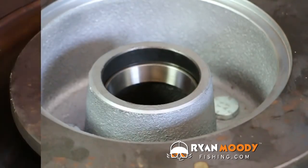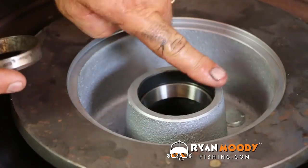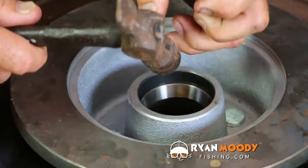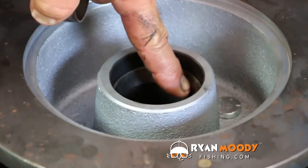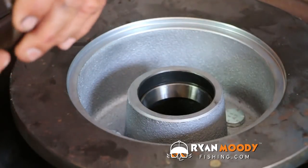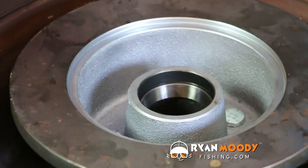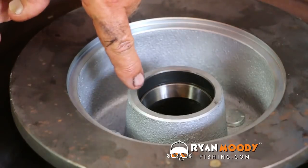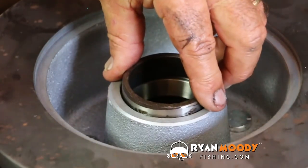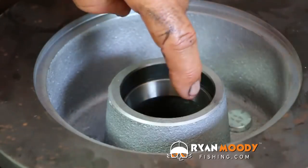But before we insert the bearing, the main point of this exercise was to show you not just how to make this tool but the reason behind it. When that sleeve was up flush, the only other way most people could get it down would be to try and hit it with a punch of some sort. But what that's going to do is you're going to slide off that little lip all the time and you're going to gouge the nice shiny edges of the sleeve that the roller rolls on. Any little gouges in there are going to destroy your bearings in no time at all and they're going to collapse on you on the highway. So that's why it's very important not to chip anything or scratch inside that sleeve. Simply putting that tool on top and belting it in, all the weight comes on the outside of the sleeve right around the entire thing, so you haven't got to worry about scouring up your sleeves.